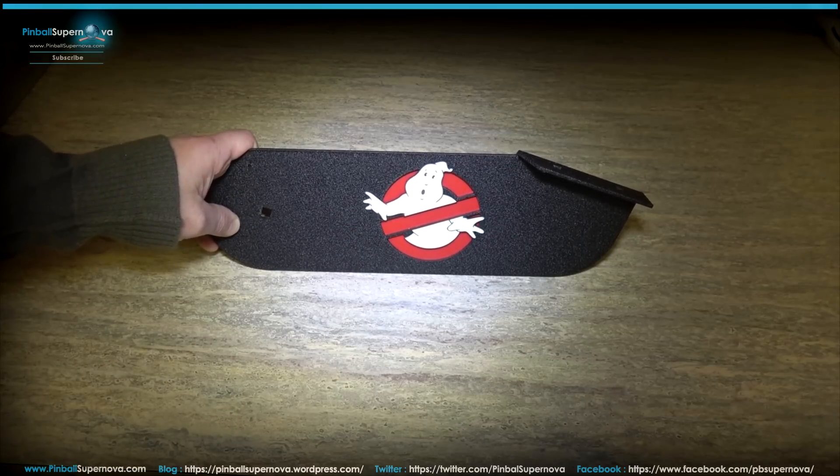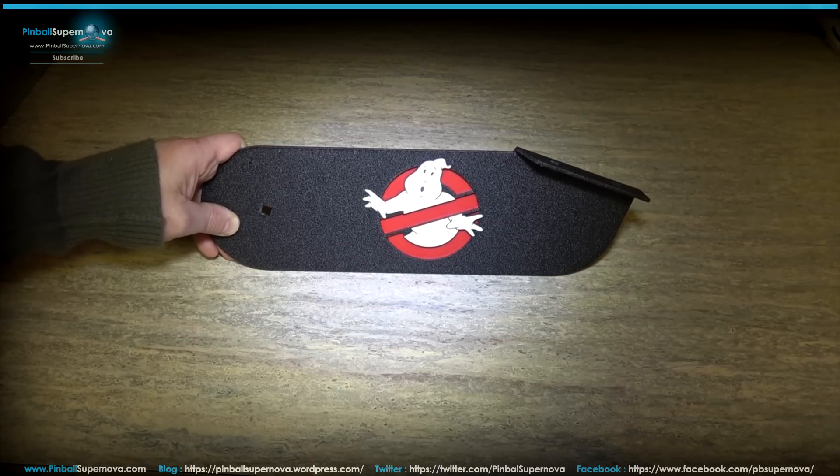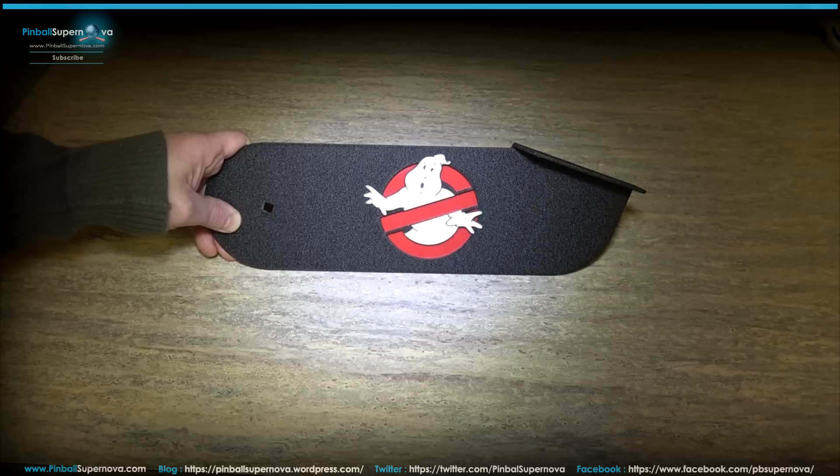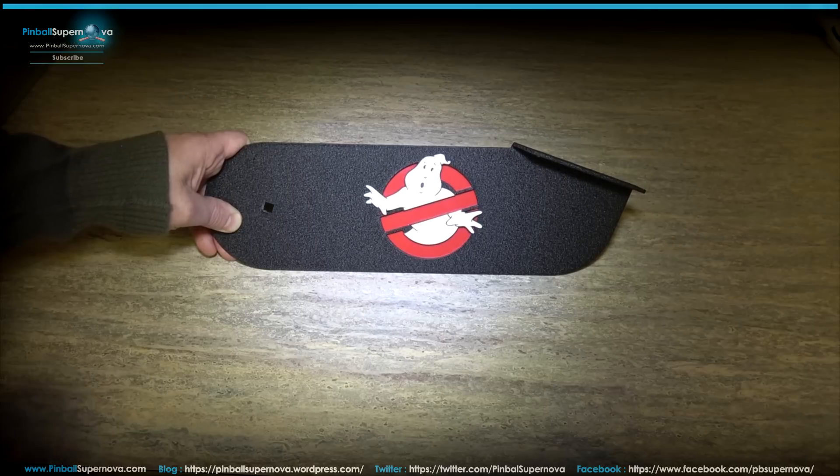In this video we're going to install these hinges on the pinball machine. They install fairly easily — there are about three bolts to take off each side. On the right-hand side we need to remove the power supply box to get to the hinge, then loosen the two bolts in the back box to put the new hinges on.